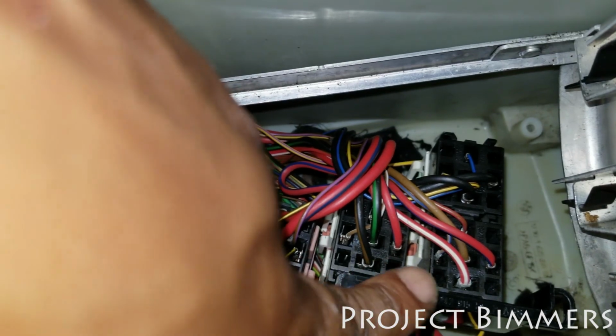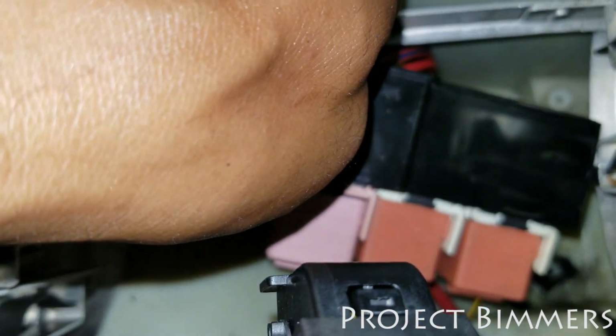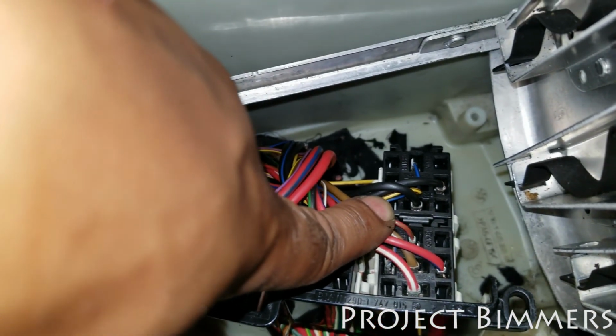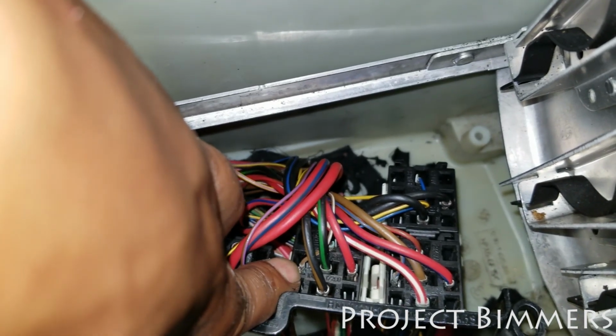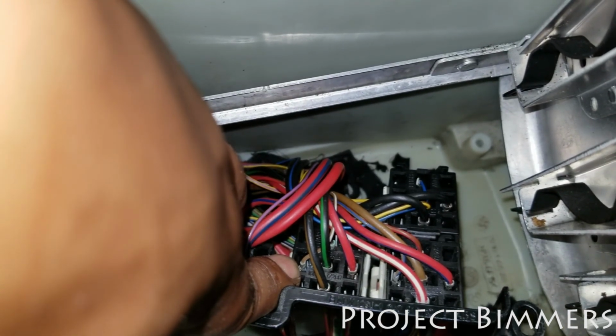These two relays here are for the window wipers, and they're the two little peach-colored ones. The wires that you're looking for are these ones on the corners, the little skinny ones over here. These are the switch wires. The ones over here, the skinny ones on the top, those are wired into the fuse boxes. So you should have 12 volts on these if you want to test. These you should get ground. You shouldn't have it yet, but you should get it when you turn on your switch for the windshield wipers